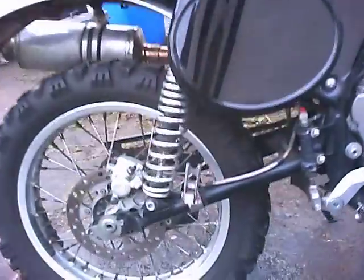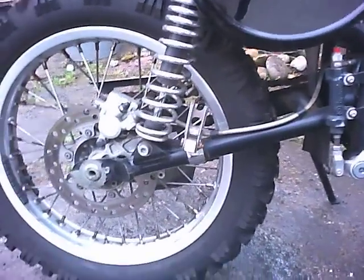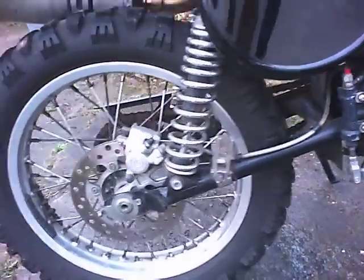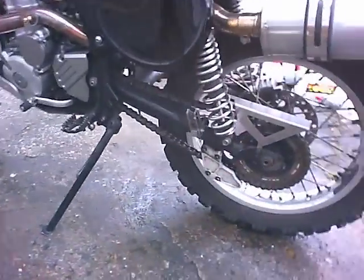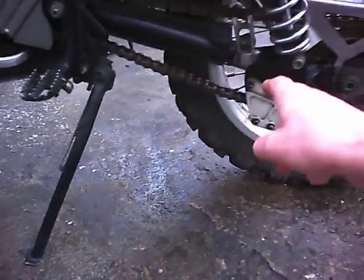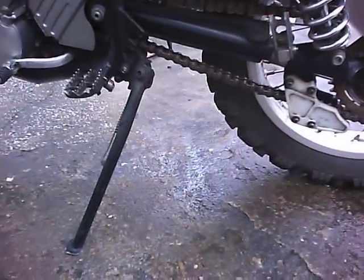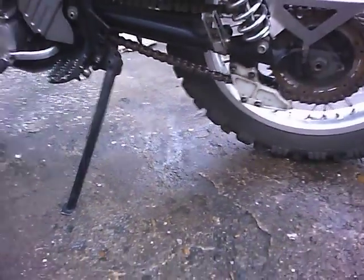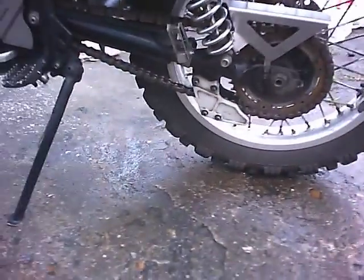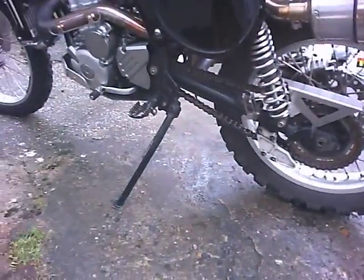You see it's got aftermarket rear footrests. They're chopped down because they're not standard on the bike. The reason they're chopped down is because if you don't, the long side stand there is fouled by them and you can't get the side stand up, so they therefore need to be chopped down, but they work fine. I've never heard of a better idea for that.